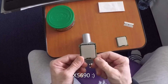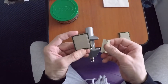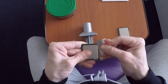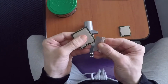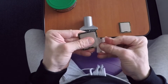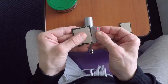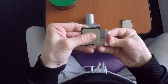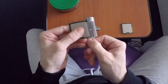The main thing is with this method I combined the methods I found and chose the safest approach. As you can see, I'm using the razor blade to cut the corner first. In the end you're going to see that there are no capacitors in this area on that side of the CPU where I started. Just align your blade parallel — the bottom part of the blade with the CPU die, as I'm showing — and just cut right to the...